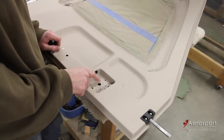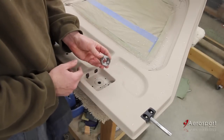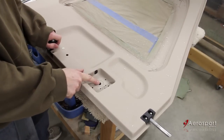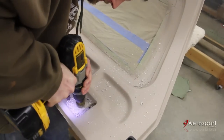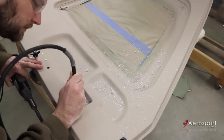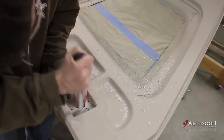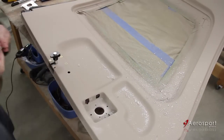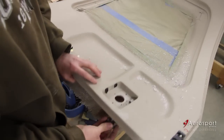With the lock hole, I'm actually going to find the center point by basically connecting the corners here, because this hole is going to have to be drilled out bigger than the hole in the template itself. We can then cut the center hole out right to our mark. When cutting it out, we want to make sure it's just big enough to fit this inner ring and have it rotate smoothly but not have a big gap around it. I'm going to make that hole with a stepper bit and some files and some sandpaper. We've got our big hole cut and the inner ring fits nice and smooth in there — no binding.